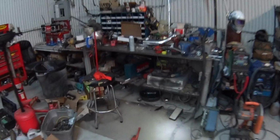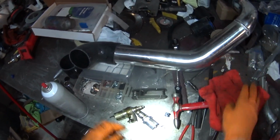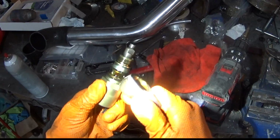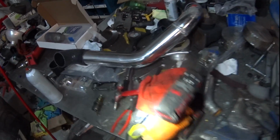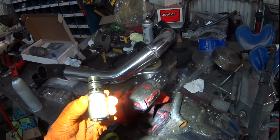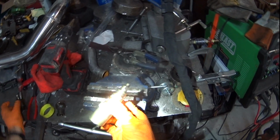But basically there's this factory, like, I don't know, a pressure reducing valve. When I got my S14 drift car going for the first time, I was like, why is my power steering all weird? And it's definitely weird, because it has O-ring, O-ring, O-ring, and then in here you can't see any orifices or holes. So what I did with this one, the one actually out of my drift car, is I gutted it. This one I kind of bit on with some things and it looked a little bit ugly, and this one's a little bit prettier.